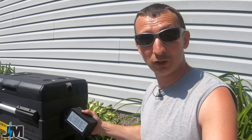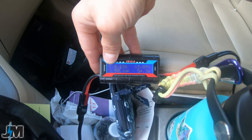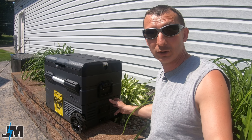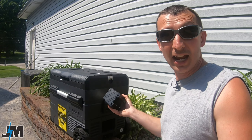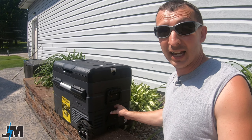We're going to pre-chill this with my portable power station. You can also pre-chill it with the 12-volt AC adapter that plugs into the wall, which uses about 90 watts since the power adapter isn't very efficient. Then we'll put the battery in, plug it into the car's cigarette lighter port on the way there — it should run off the car — and once the car shuts off it'll run on the battery. This is a 173 watt-hour battery.